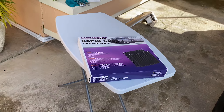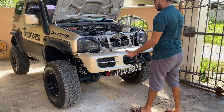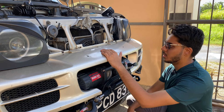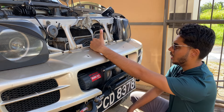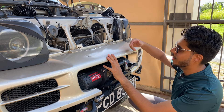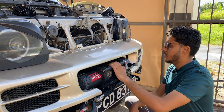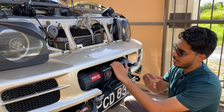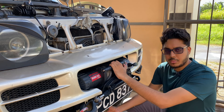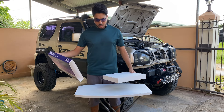You're probably thinking, why not just relocate the transmission cooler to the middle? If you relocate the transmission cooler behind the winch, there's not going to be a lot of airflow to cool it, and because it's a snug fit there's not a lot of room — we're going to limit the airflow to the AC condenser and the AC won't cool as much. So I prefer cold air, and the solution to all of that is a smaller transmission cooler.